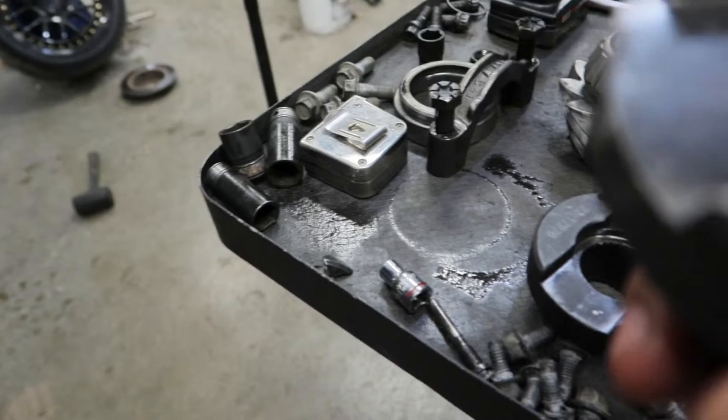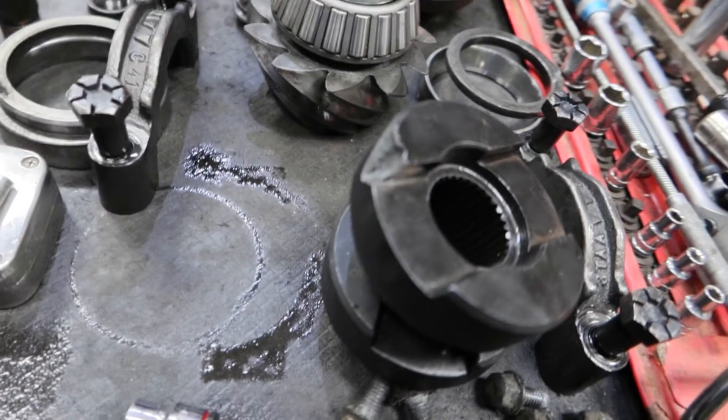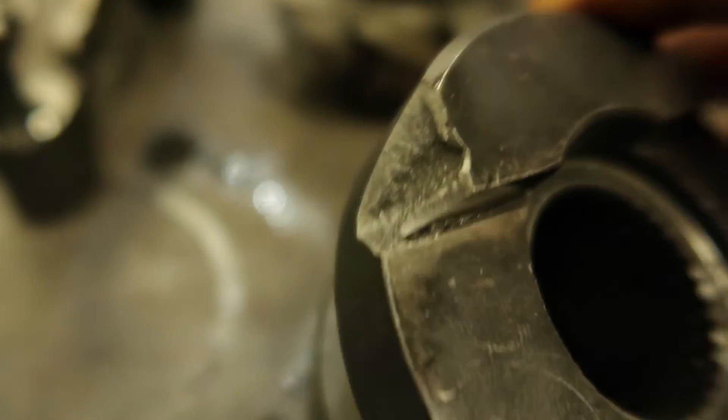You can't reuse this carrier because these spider gears are broken — you can see here it's not just chipped, the whole thing is actually cracked throughout. Even this one was getting ready to break off, and this one's cracked across. Can't reuse these, so we might grab another 8.8 carrier — at least if we can get the spider gears, it needs to be a 31-spline because I use 31-spline axles. I think I have something lined up from a local guy to just weld it and go.